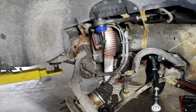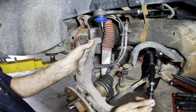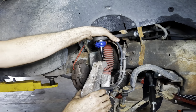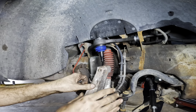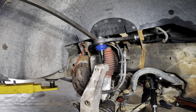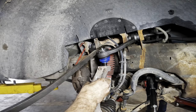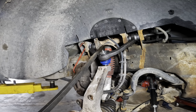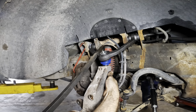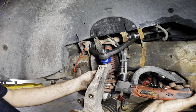Let's go ahead and line this knuckle up with the upper ball joint. If it's gonna come down that far, I tightened it while it was up in the air, and now it's kind of hovering. I will pry bar it down, that'll work. More pry bar, and it's the big one, the 4-footer. There goes the flashlight. I'm gonna pry this guy right down like so. Then I can come around with the castle nut on the backside, get that thing threaded in, good to go. Clean. Incoming impact clickages.